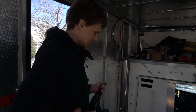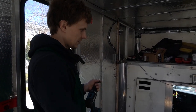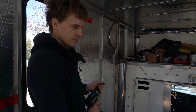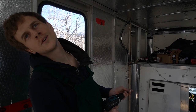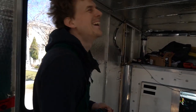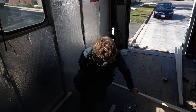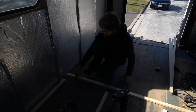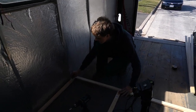So we are ready to put in the floor insulation, put in some spacers, then we have some insulation panels, and on top we will put some... Are you checking to see if the microphone is on? Yes. It's on! Why don't you trust me? Plywood gets on the top. We're just creating the frame now where the insulation, we got the same sheet panel insulation. And on top of that, plywood, and then flooring.